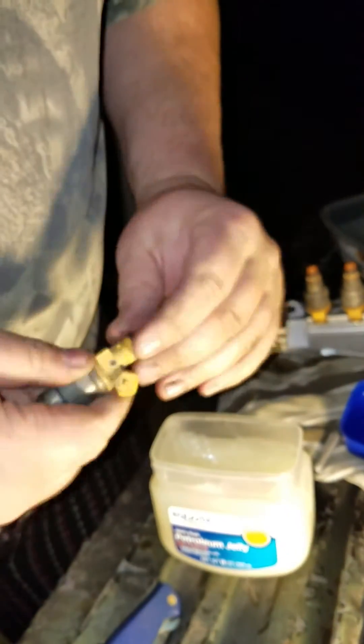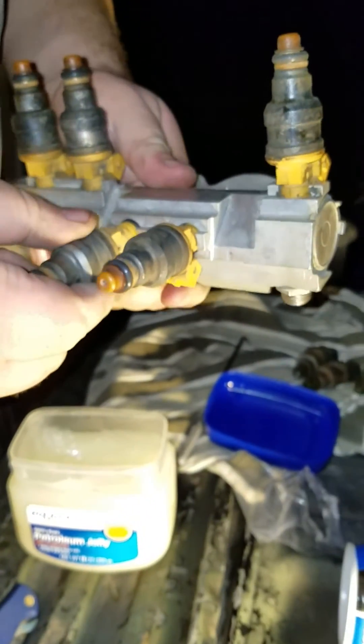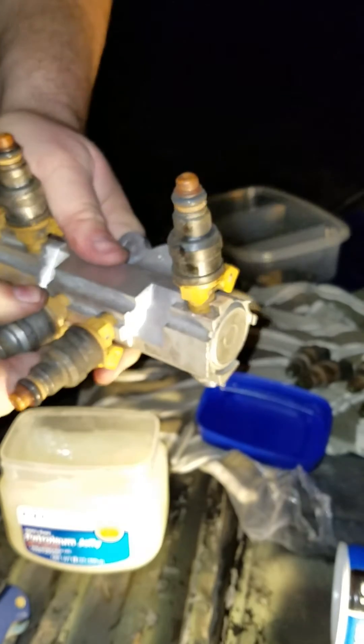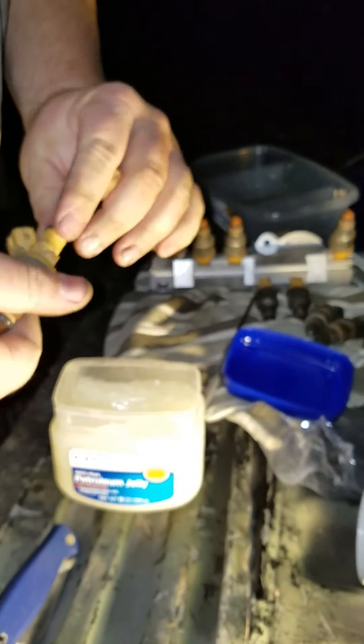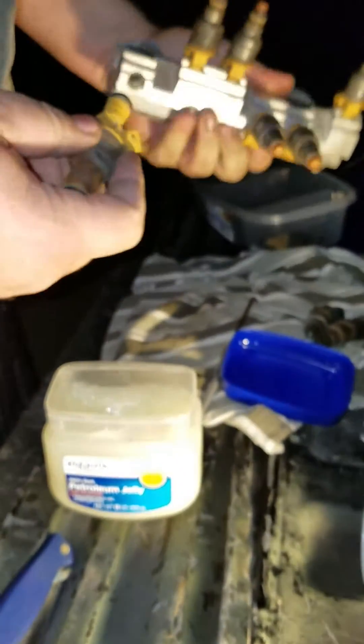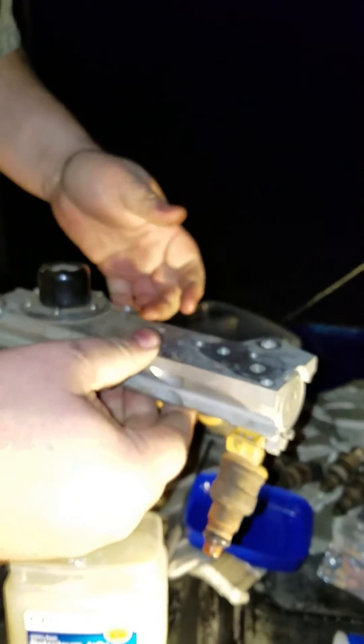Should almost kind of snap in place — pretty straightforward, pretty easy reassembly. These are 19 pounds out of the F-150. Did you hear that snap? She is good to go, gentlemen. Not too much lube, because you don't want the fuel to go by.